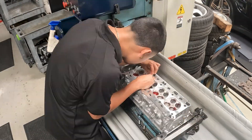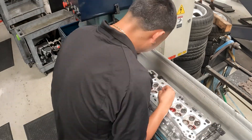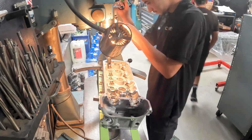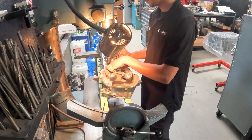Once the motor is received at Carbon, they tear the motor down. They inspect the guides for wear, inspect all the valves, all the seats, all the camshafts, all the camshaft journals, lifter bores, all the vanos gears, and they check all the surfaces to make sure that they're good to go.